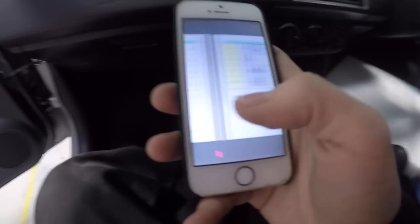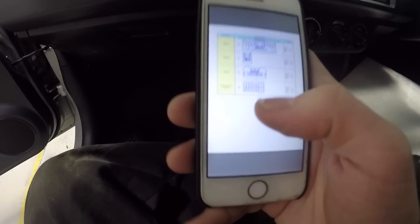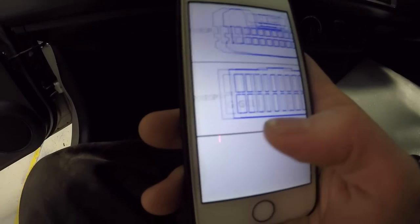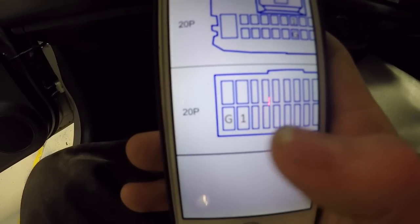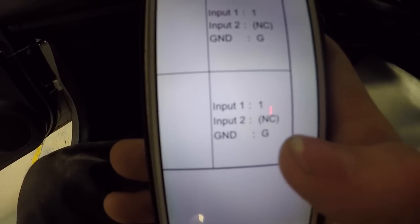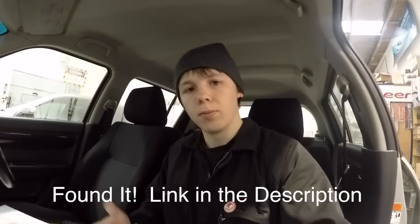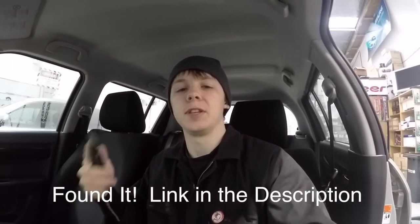I have a PDF with Japanese car plugs and wiring diagrams pre-loaded. I just go across to Suzuki, find the 20-pin connector, and it tells me the shape of the plug, that the reference ground is in that corner, and steering wheel control wire one is there — there's no two, so I only need to hook up one. Input one is number one, input two is not connected, and ground is G. Grant who works with me linked this to me — he got it from the Sony website, so you could look around there.